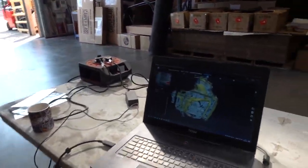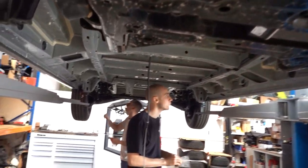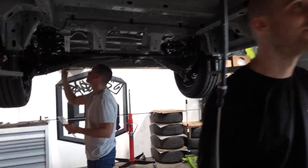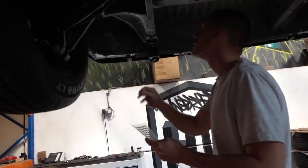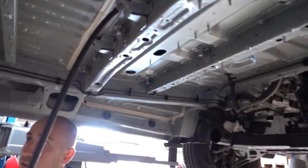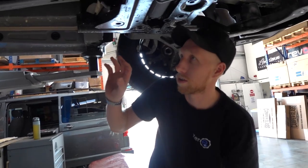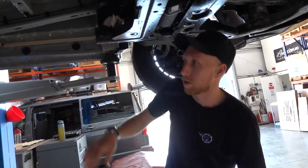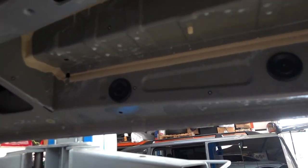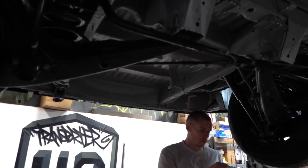Chris has been scanning the underside of the engine bay, which should give us a really accurate idea of where we can mount stuff and the dimensions so we can start fabricating some bits. This is Neil — he's going to be working with us on this project. These guys are currently sticking on little dots to help with the laser scan. The reason for the dots is that the scanner will probably lose its reference point as it goes along because it's so similar under there, so the dots are randomly scattered to give it points to pick up on so it knows where it is as it scans.